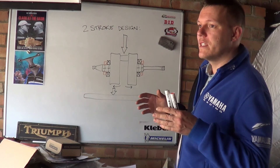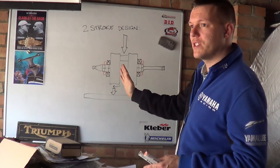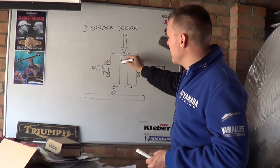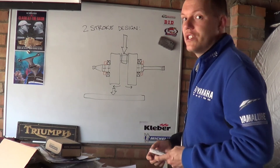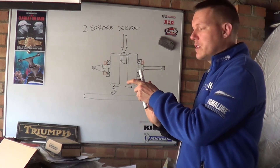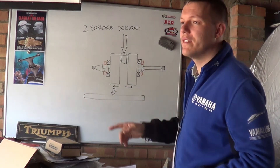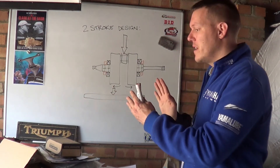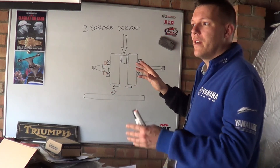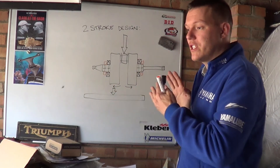The other thing is thrusting. This crankshaft is going to thrust from side to side because the con rod has some wiggle room, it has some play, and you usually have plain thrust bearings or thrust spacers — thrust washers, whatever you want to call them. There is thrusting: the piston and the con rod where your wrist pin is, there is some movement there. So this entire crankshaft can and will — because of the gearing, especially if it has a helical primary drive — thrust backwards and forwards. And if your bearings are all the way out here, there is nothing to stop that thrusting — there is just a shitty oil seal.